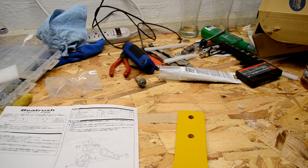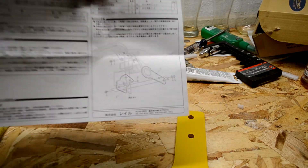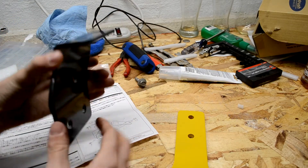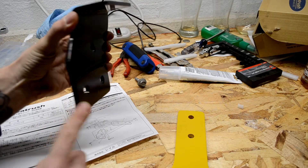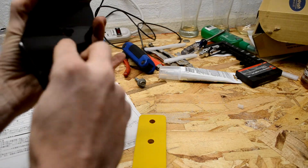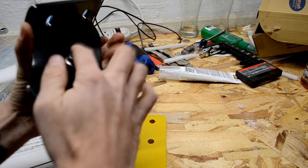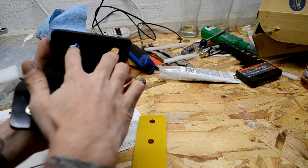We got the old tow hook off — it was actually pretty easy to do, so I'm kind of surprised about that. Here are the directions straight from Beat Rush. I can't read Japanese, but luckily I can read pictures. The 90-degree piece is going to go onto the car, and then this angled piece is going towards the rear of the car. The tow hook will be placed on here just like this. As far as hardware, they give you three bolts: two are going into here for your new tow hook, and your last one goes into the piece that connects to the side. You'll use the previous old two bolts to connect into the car.